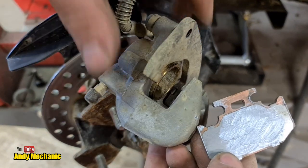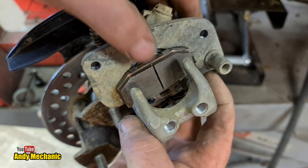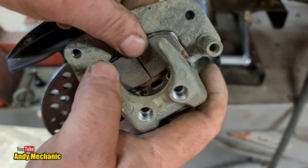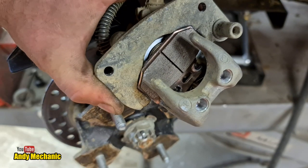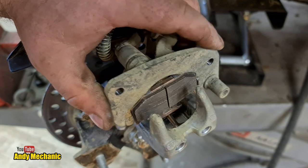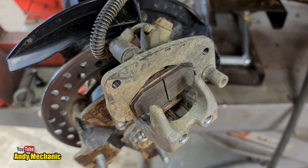This pad can now go back into the caliper. We just drop it down there - remember it's spring loaded, so we just push down against that bottom spring and it should snap into place. There we go - it's now held. We haven't got any of the silvery stuff on the brake pad, which is always good. There's no point sanding the brake pad - they're just going to wear down even quicker then. This brake pad is matched to this disc - it's happy. Why waste brake pad?